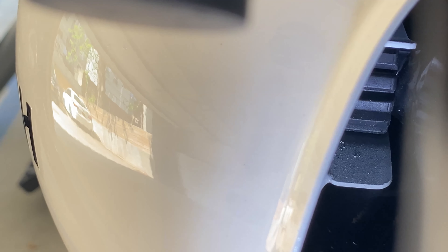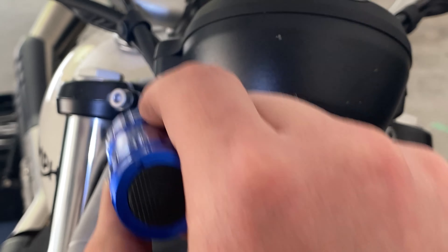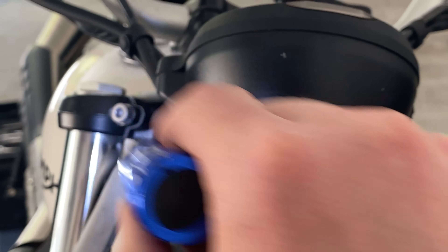When you put your tank back on, triple check it is correctly seated on these rubber pads. It's difficult to see, but if you look where the flashlight is flashing you'll see that the metal part of the tank has one part on top and one part on the bottom of the rubber pad — that's how you want it, wrapping around the rubber padding. A good way to confirm it's correctly mounted is that everything should be tight and close together. Once the bolt is back in, grab your tank and give it a pull upward — if it moves up, that's wrong. Now you know it's seated correctly and not going to be dangerous.